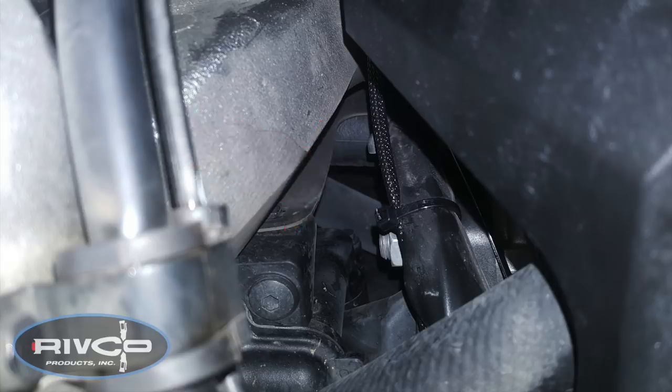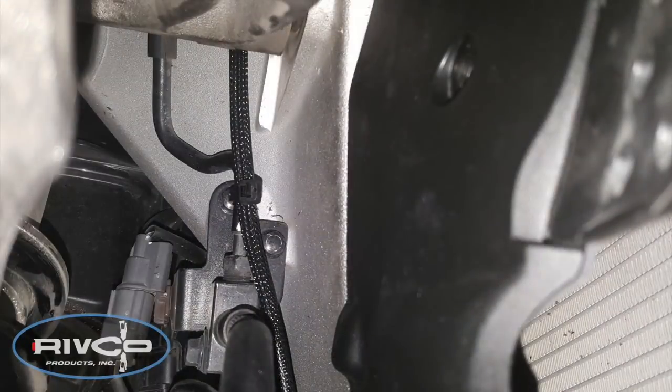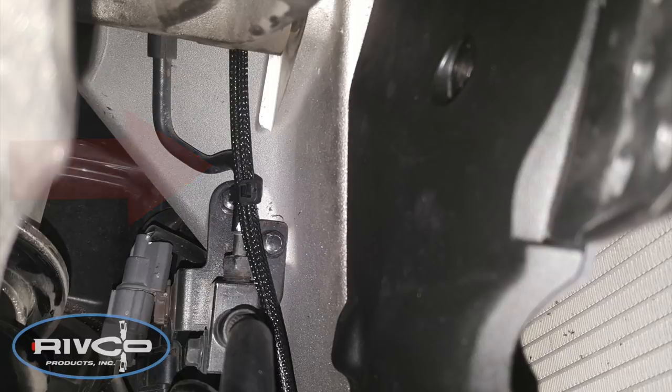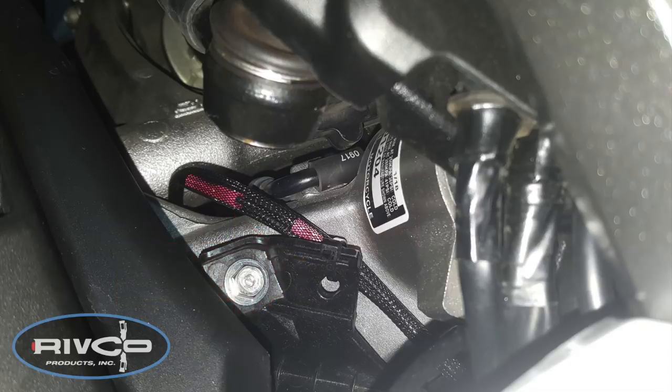To give you a perspective — on the left hand side of the bike looking up, you can see the radiator hose down at the bottom right, and there's the cable tie and our shielded wire. Moving a little further up through that tunnel, you'll find a hydraulic pipe that we can also use a cable tie to connect our wire to. The wire eventually comes out between the steering head and the frame. There's a little bracket meant to hold a hydraulic pipe for the clutch transmission — I have a DCT so this hole is not used, and you can cable tie to that hole.